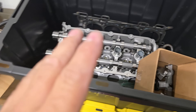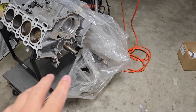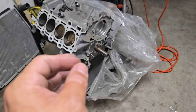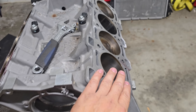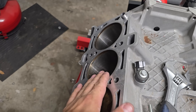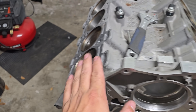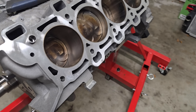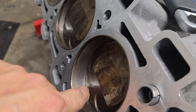I'll show you everything that's in there. But first, let me get that on so I can flip it around and take a look at the bores, and see if I can identify which cylinder had the ring land failure. Looking at the Coyote from the front — meaning the crank side — this is number 1, 2, 3, 4, 5, 6, 7, 8. Bank 1 and bank 2, for those of you that want to know. I'm going to rotate starting on number 1.